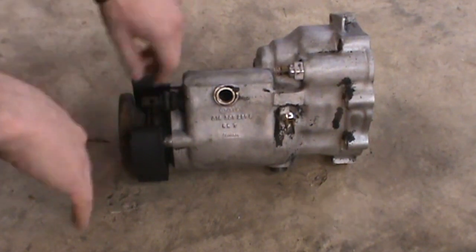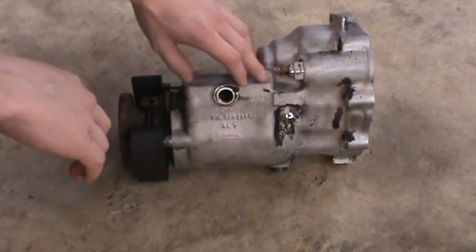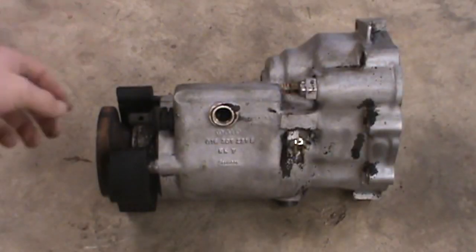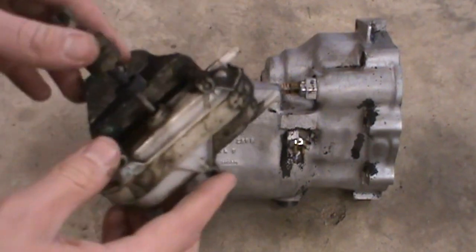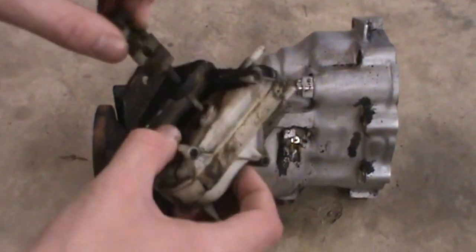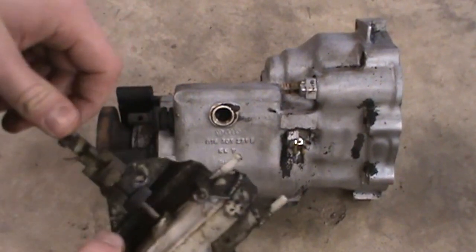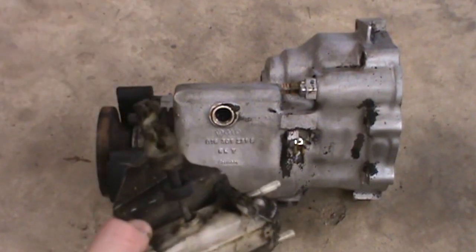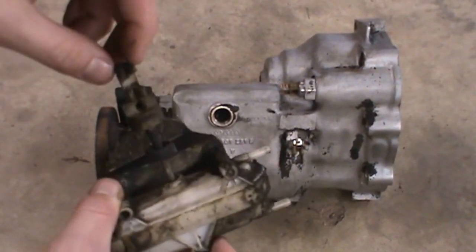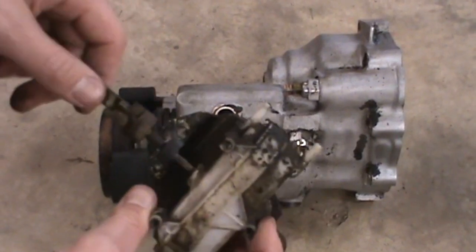The B2s were still using an open differential, so you needed to lock it to maintain traction, and this is the mechanical locker for that — there's an external lever with a vacuum box that pulls it. If you're swapping into a 4000, you'll need this differential lock unless you just don't care about locking differentials. Speaking of which, this vacuum box is really old, it's got a lot of cracks in it and I'm pretty sure it doesn't work anymore. So I'm replacing it with a solenoid actuator — it was meant to be a door lock actuator — I found two on Amazon for $10. Ordering a new vacuum box is about $60, so I'll post a link to that alternative in the description.